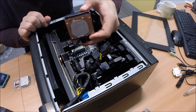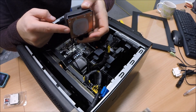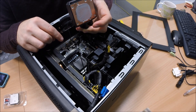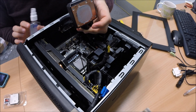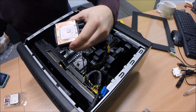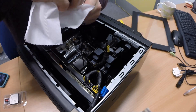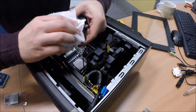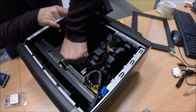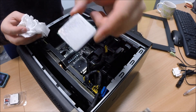We're going to clean all of the existing thermal compound off of here and the processor itself. So we're going to clean off the existing thermal compound from the copper cooling block and on the processor itself. Most people would use an alcohol wipe or alcohol gel, so we're going to go ahead and use some hand sanitizer to clean it — it's alcohol-based, 100% alcohol, so that will clean it nicely. As you can see, that's more or less clean enough. Let's go ahead and do the processor next. Take the processor out and do the same thing — it needs cleaning, it's just covered in thermal paste, probably a bit too much actually.